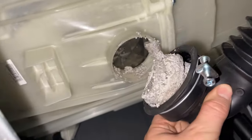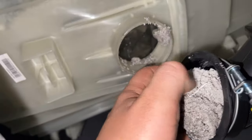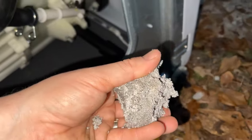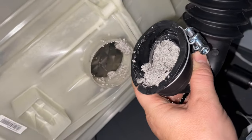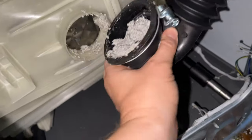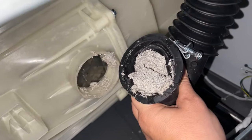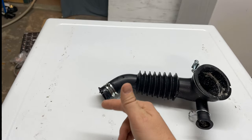There's this white substance all over it. When you reach underneath there and feel it, it's like a bag of sand. Some front load washers have a ball that sits on top of this area to float and catch debris before it goes into the pump. This one did not have that, but I could feel something like a ball and something underneath it that felt like a bag of sand. It was just packed full of this stuff — when it hit the ribs it just started building up and building up, eventually completely clogging it. I'm sure it was slow and steady draining out over time.